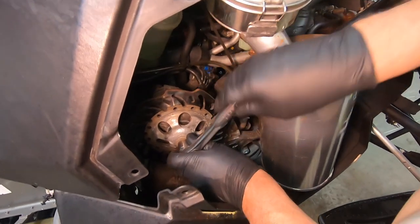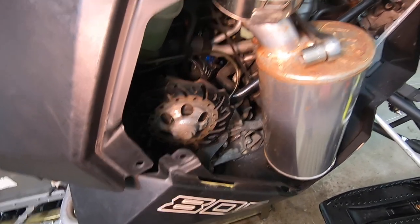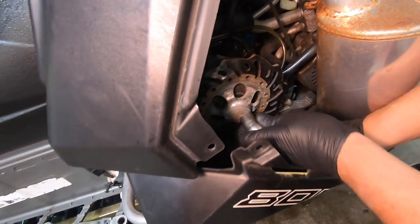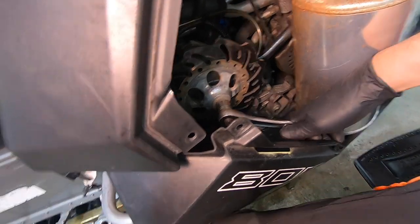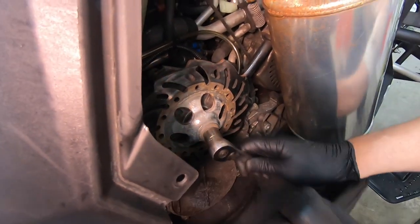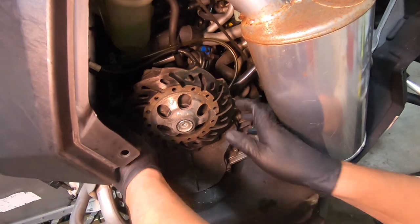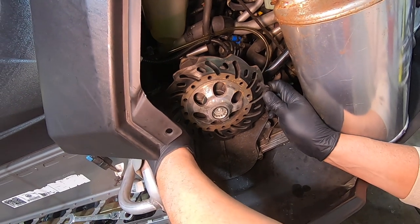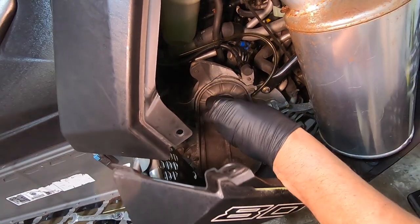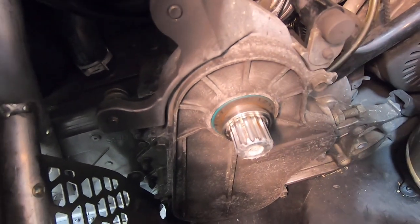Now we're going to remove the brake rotor. I'm going to lock the brake — oh, that ain't going to work. I should have done that first. We're probably going to have to hold the track. All right, we're going to remove the brake rotor. All we did is we put an impact on that and just held the secondary on the other side and it kept it from turning. Then we have this spacer that's on there, so I've got to see if I can remove that.